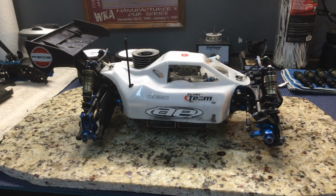So droop is really important, guys, especially coming off a jump. If you have too much droop coming off of a jump, the car's going to kick one way or the other. If you have too much droop, it has too far to travel in the air, and it's going to make the car not fly correctly. Less droop, there's less movement in the air, and the car's going to fly a little bit better. I know the first thing we all think is, let's put a lot of droop in it, have a lot of absorption, so when we jump these big ramps, it'll absorb it.